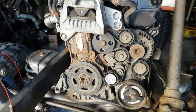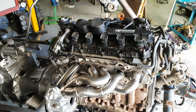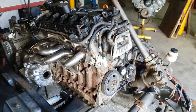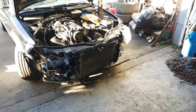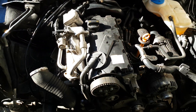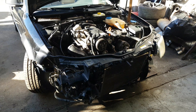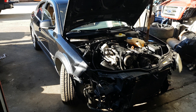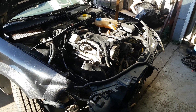This is a 2.5 out of what I think is a 2008 Volkswagen Rabbit — it makes a lot of torque, a little more power than the original M180 that was in this. However, this is a better option here: this is a 2005 Seat TDI, the two-liter diesel. From what I understand, these will make 305 foot-pounds of torque with just a tune. I came across this car the other day, so I think this is going to be the engine we'll use for this swap.